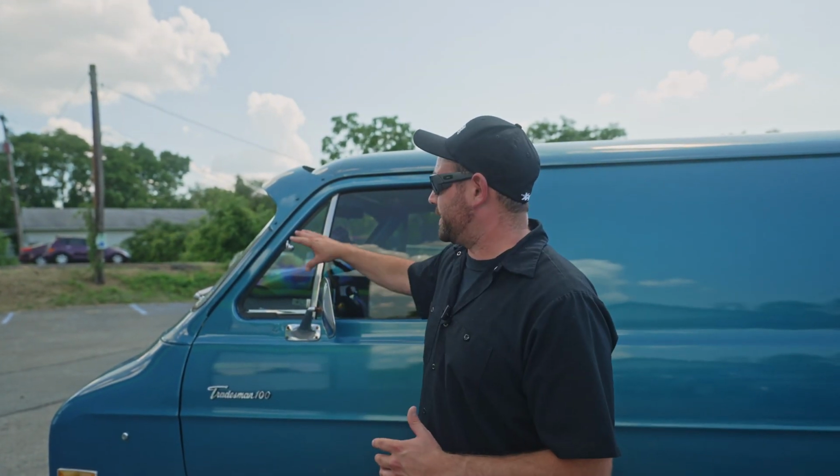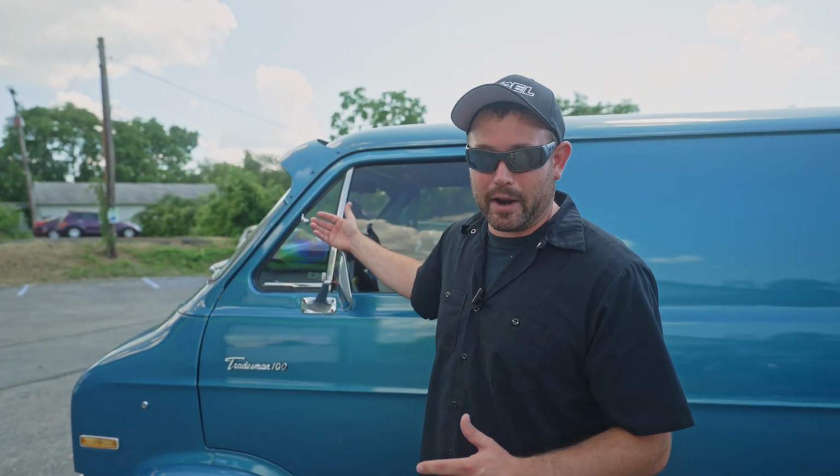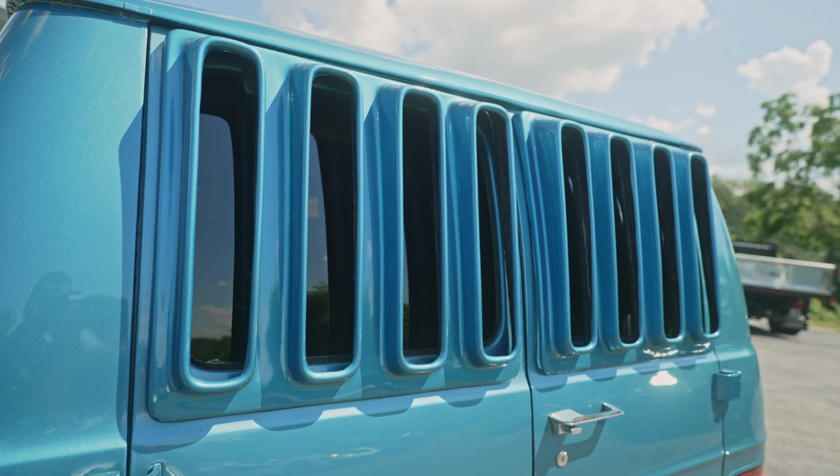We got super lucky on this one. This car is in great shape. We were able to take it apart. The glass actually pulled out of the frame on this, so we had just a bare piece of glass. And basically the same thing on the back. All of the hardware came apart smoothly, and we had just a piece of glass. So we were able to tint it. We let it dry outside, and then we shaved all the edges, so it gives it that perfect factory look, even on something this old.